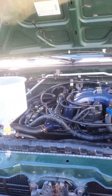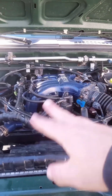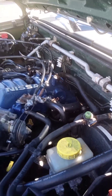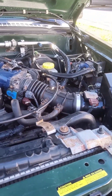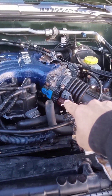I thought maybe I had some air in my coolant system from removing all of this many times. I also changed my idle air controller — I've got to reset that back to what it was. I kind of adjusted the screw a little bit, so I'm going to back that off to where it was. But what I actually believe is the culprit is my throttle position sensor.